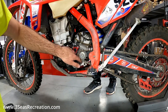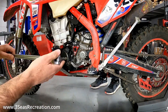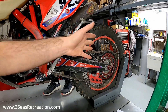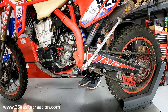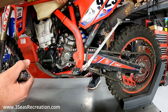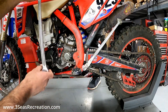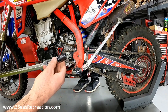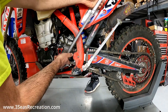All right, to do this all we have to do is remove the front sprocket so we can get to that seal behind there. The bike is in a holder keeping it straight up and down, but we'll have Braxton stand on the rear brake as well. If you're at a track with a stand and the wheel is off the ground, you can have a rider stand on your rear brake to hold the rear wheel still so you can unscrew this. All we're going to do is take our breaker bar — it's a 17 millimeter — and I use a six-point socket when I do these.